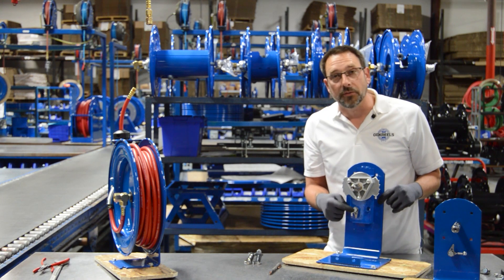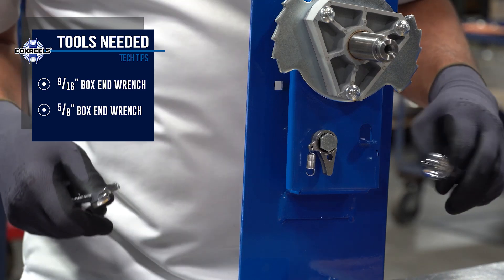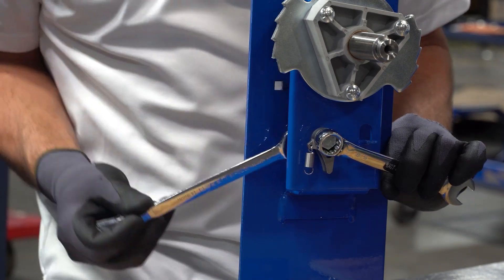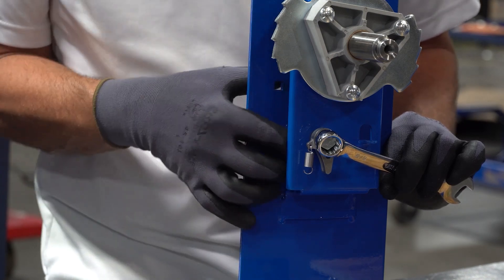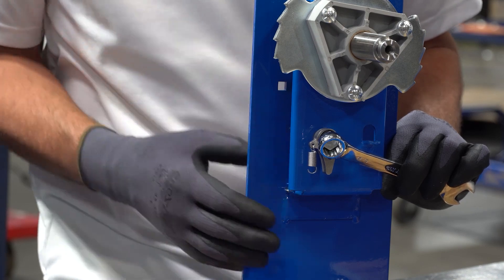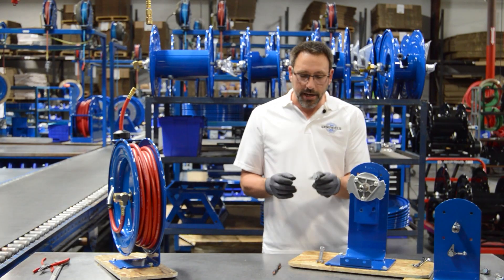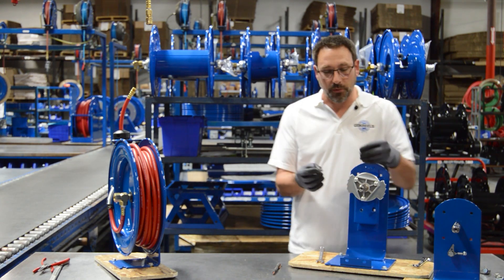Then what we're going to do is remove this nut — that's going to be a 5/8 wrench and a 9/16 wrench. We'll reach around without using our thumbs, hold with the 5/8 and undo the hardware with the 9/16 in the back. Get it loose, take the nut off, and then remove the hardware assembly. Now that I have this off, we're going to pretend that the spring was broken and we're going to replace it with our new spring.